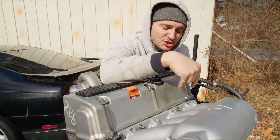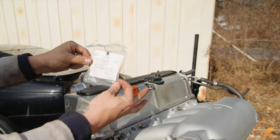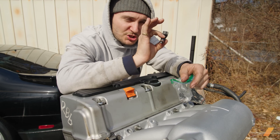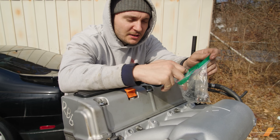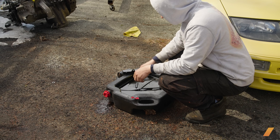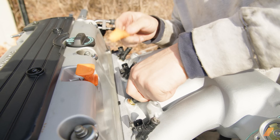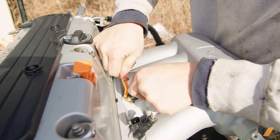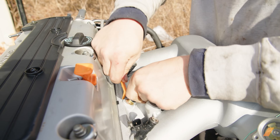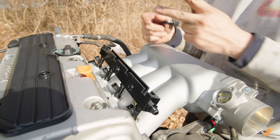For now, I'm going to start mating the injectors and fuel rail up to the intake manifold. K-Power Industries provides a whole list of bolts, and these two are for the fuel rail. These are South Bay Injector 1050s, which should be good up to mid-500s horsepower if my math is correct. I'm going to start popping these in and see how they fit. Using my old motor oil to grease up the fittings. There's a second set of seals going into the fuel rail that were very stubborn. I'll leave it like this for now, knowing it's going to be a return system since there's a feed and a return on the 944.